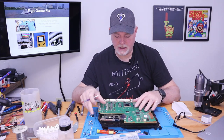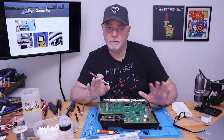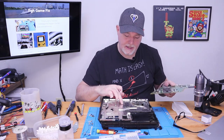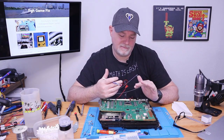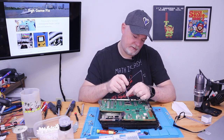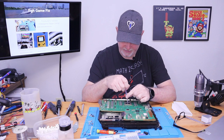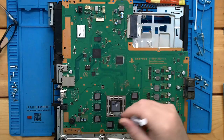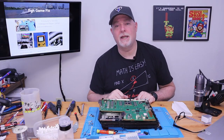Not to mention, there's flexing in the board, there's flexing in this chassis. If you make a perfect little smear, and I'm not saying that the guys doing that are wrong by any means, but if you do that, and you haven't quite filled in all the gaps, and not to mention, that's not even a smooth surface, you're leaving a lot unprotected. The reality is, all you need to do is put maybe not quite a BB-sized dollop in the middle, but, as one of the other channels always says, the perfect amount. And the reality is that's all you need.